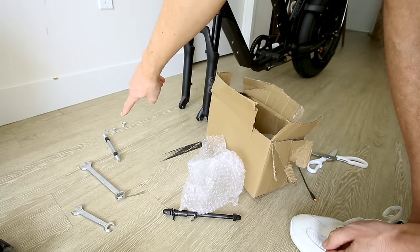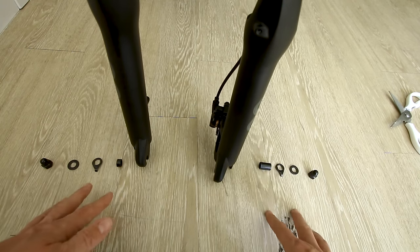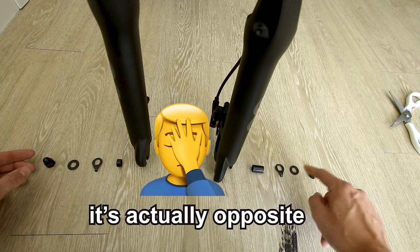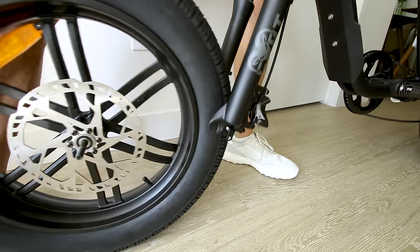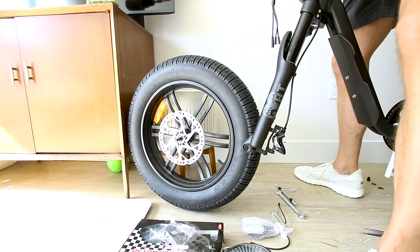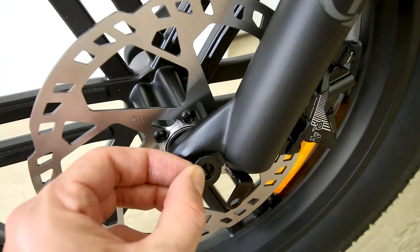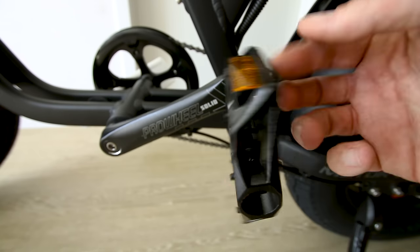Turn signals for our bicycle. For those of you who do order this bike — because let's be honest, a lot of people are — the big nut goes on the right side, then the spacer, then the washer, then the small one first. Pull out the piece between the brakes, then the axle. You really need two people for this. Small one on the brake rotor side, then the big one on the other side, drop that piece in, washer on, fender on, turn signal on, headlight on.